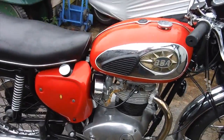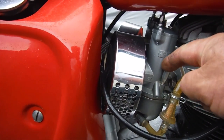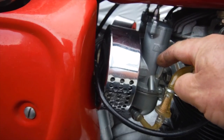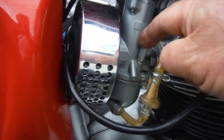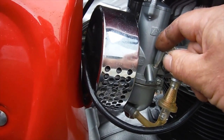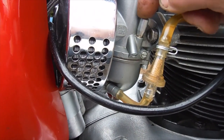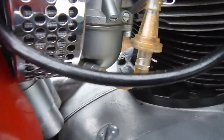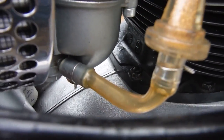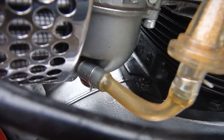The first thing I'm going to look at is getting some fuel into this carburettor — oh hello, hang on, all of a sudden, maybe the float was stuck. Now it seems to be responding. When I jab the tickler you can see activity in that fuel pipe; if I just hold it down you can't really tell what's happening. So I shall jab — there we are, we've got fuel at that carburettor. Let's just give it another try.